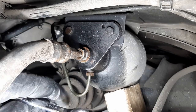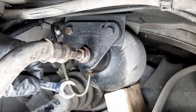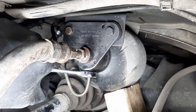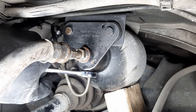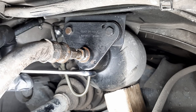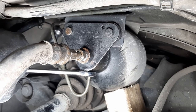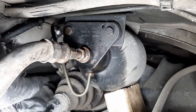The size of the nut on this hardline is a more standard size. It's 11 millimeters, and I have a line wrench or a flare nut wrench for that. So hopefully it helps. It's the kind of thing where you'll bust your knuckles if you push too hard. Wow. Another difficult one. Okay, I'll grab a regular wrench to get more leverage. Okay, so leverage extension activated with this longer wrench. Oh man, I even made a mark here with the wrench.